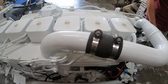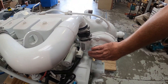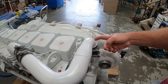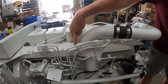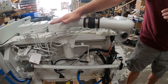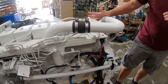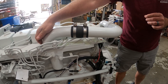Talking about the intake air: on the turbo we have the intake side of the turbo, and the other side is the exhaust side that goes out. Once the air is compressed by the turbo, it runs up through this tube and gets ported directly into the engine intake manifold. This particular engine, since it's a low-horsepower 5.9, an aftercooler — which would normally cool the air that gets heated up by compressing it — is not required. So the air from the turbo just goes straight into the engine.